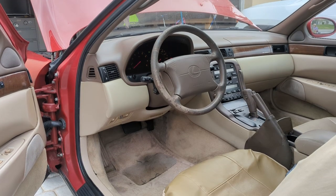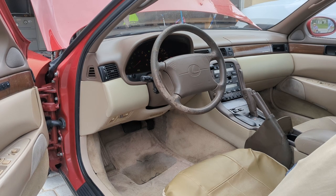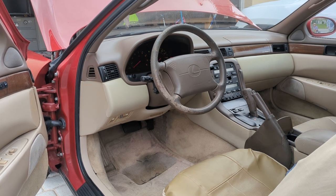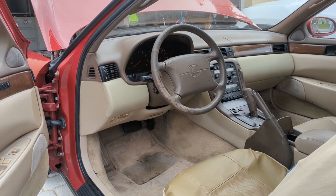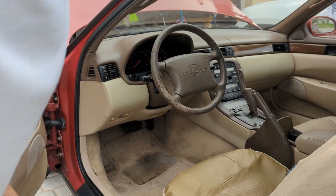All right, I'm not really sure what's going on here, so I'm going to disconnect the jumper wire because I see the overdrive light and the check engine light flashing constantly, but not in any pattern other than on, off, on, off, just a repeatable pattern. So I'm going to put it into what I think the manual calls enhanced diagnostic mode, where you short E1 and TE2 on this connector buried way under there. I can't get the camera in there, but I'll show you.